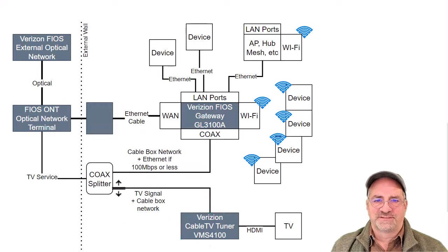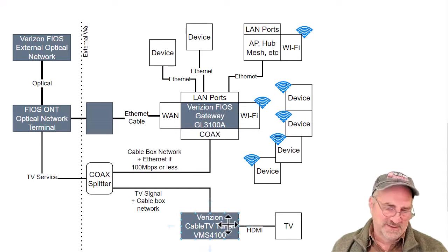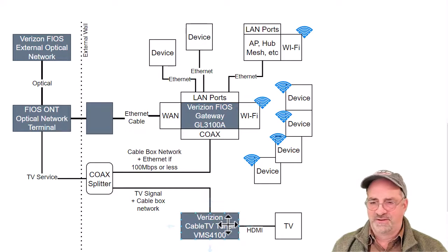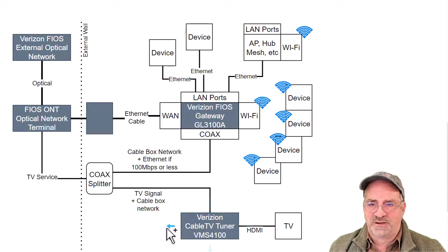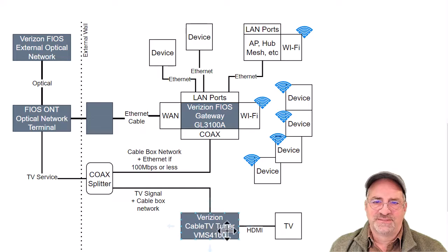When I moved the box, I thought I saw the TV cable signal and assumed I was fine. I thought these tuner boxes either talked back on the cable to the head, or at one time some of them talked Wi-Fi to the gateway — and if you changed the gateway password, you'd break it. Why do you need that? Because you need to do DVR, on-demand, buy movies, use embedded apps — anything that has to talk back to the head unit. So this tuner may or may not connect via Wi-Fi, and mine didn't.